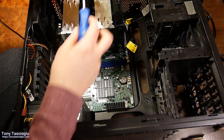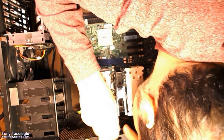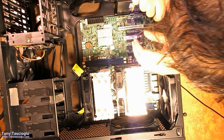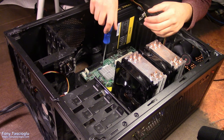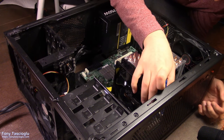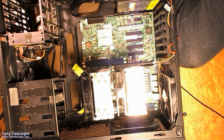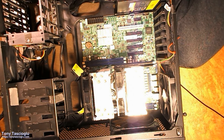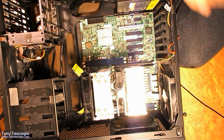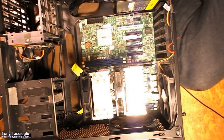And that, folks, is how you turn a screwdriver into a magnetic screwdriver. To be honest, I have no idea why I didn't just make that hack earlier. This is so effective. If you guys aren't aware, if you have a neodymium magnet, particularly a nice strong one, laying around, what you can do is just take it and rub it against your screwdriver, and now you've got a magnetic screwdriver. It's actually quite powerful now. Very nice. I leave that magnet under my desk for pretty much that reason, to magnetize non-magnetic screwdrivers usually.